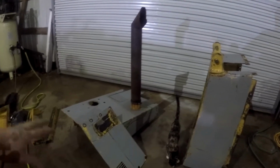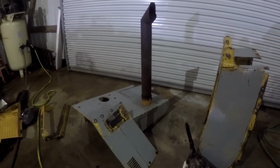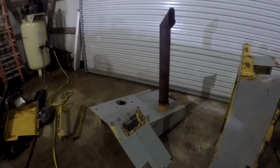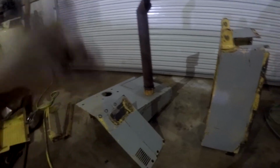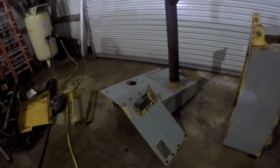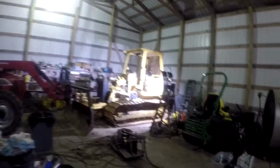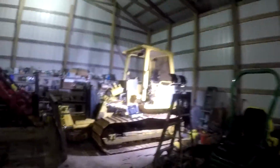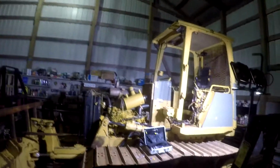So anyway, the sheet metal here, I just took the steam cleaner there with the turbo nozzle, sitting on about 225 degrees Fahrenheit, and cooked the paint off of it right there in the decals. That was the easiest way to do it, and got that done. I also got the decals off the dozer, got it kind of ready to paint, or well, it ain't 100% ready to paint, but it's closer than it was. We got it cleaned up a little bit.